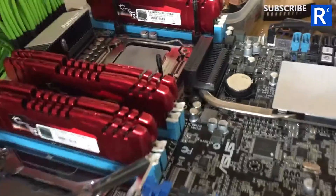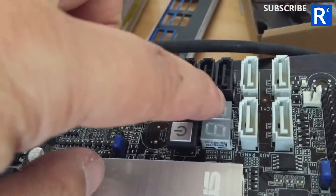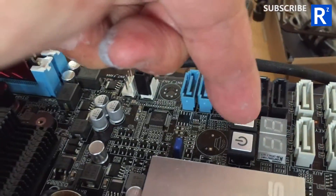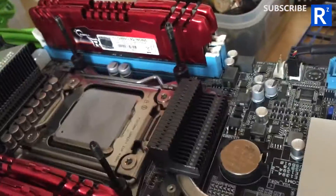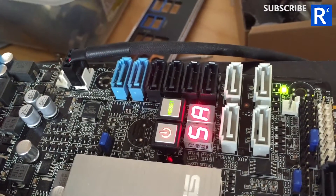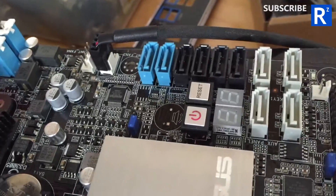Another update. This is with the original setup, but with the CPU missing. So this was the original CPU in CPU slot one, and CPU slot two is down — because whenever I put another CPU in there, the thing just doesn't boot. Right now I want to see if I repeat the whole 00 thing again. When I put that CPU in there, that would give me a 00 — I'll highlight that again in the video. Three, two, one, go. Now you see this one's giving me a digital readout, giving me a number. Switching off — don't want to burn out. So that's weird.